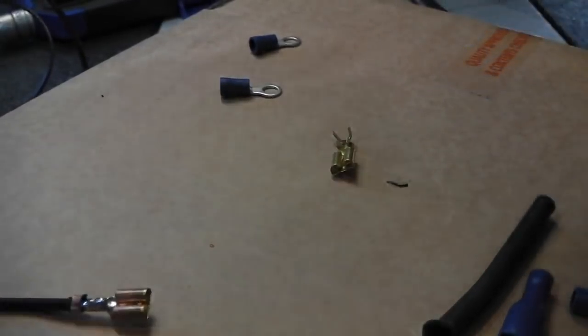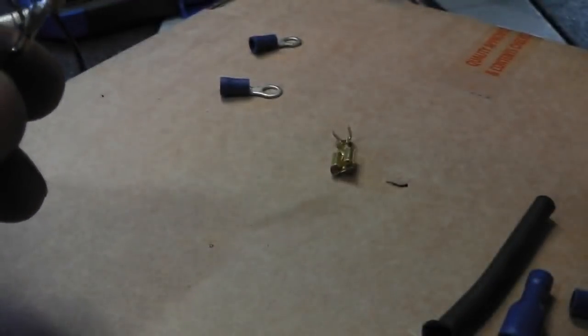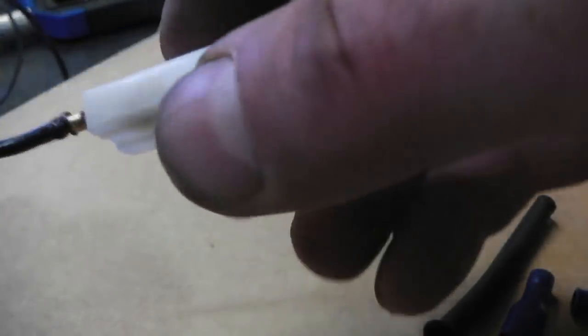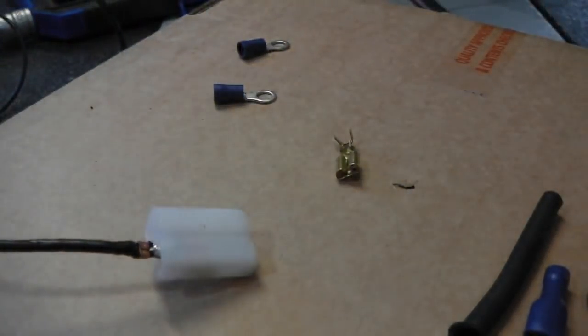Now just make sure we get the orientation right. I'm going up to the loom off screen to see which one's the neg. The neg is the top one. Now in my hand, sliding in the Lucar with the cable to the top, and that'll push in and home. I think it's that way. Yeah, it is. Right, we just need to give that a little bit of a push through, and that'll clip in a sec. The positive side, the switched side, comes out of the relay, which is in the kit. Again, you're just off screen. I'm going to take you up onto it now, and I'll show you how that works.